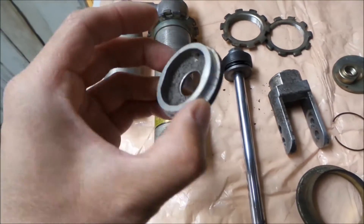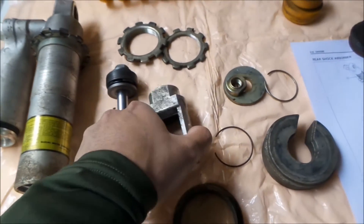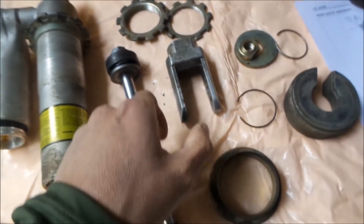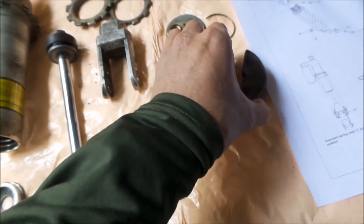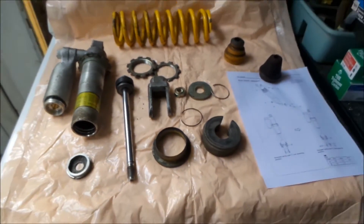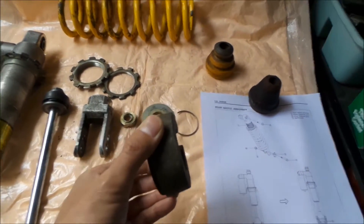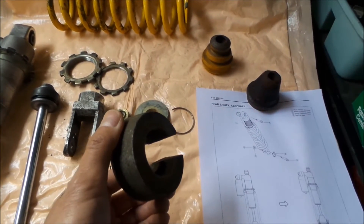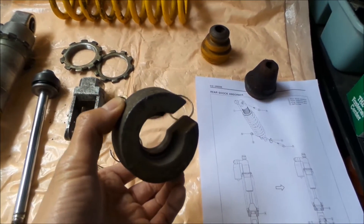This is the cover for your shaft right here. This is the clevis pin, I think it's what they call it. And these are your collar assemblies. What's very important to understand: if you're lowering the shock, you need to flip this collar around, or else what happened to me may happen to you if you bottom out the bike hard enough. Basically, what this does is it adjusts your travel.